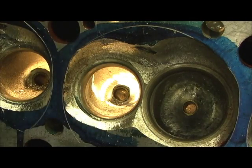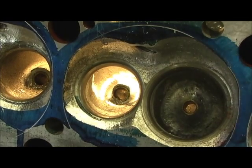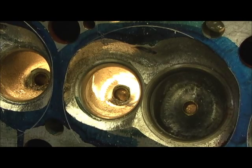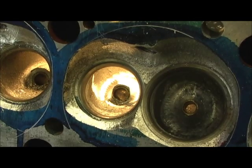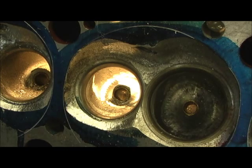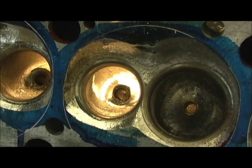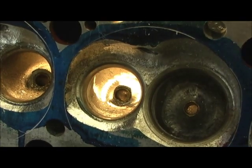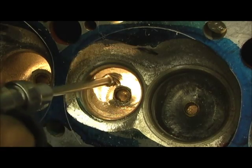I'm a little bit more fanatical and sensitive in there on the exhaust. So I've developed a methodology: the first thing I'm going to do is take the finger burr and hit all the rest of the exhaust, then come in with the big one to hit the tops, and then use this one here to try to come in on the side. I've got to be careful because it's got all that heat in it — I'll tend to leave a little bit more even though it will look a little better.